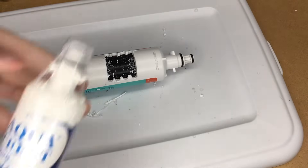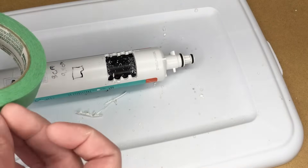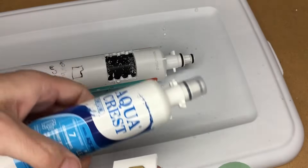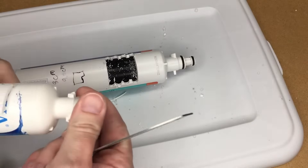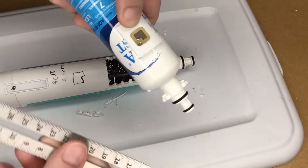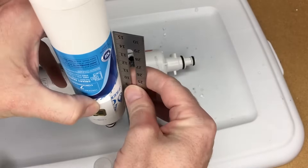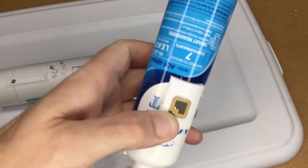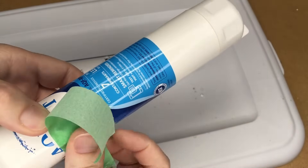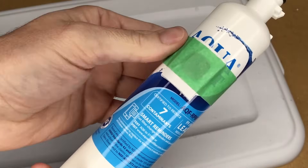That's looking better. Now I'll get the new filter out and a piece of tape. You could tape the RFID chip to the fridge in the right spot, but I'm just going to tape it to the filter for now. I had nine centimeters — it's kind of hard to show on camera, but I'm going to set this up on a surface, put the ruler next to it, and measure up to the right height. That looks good. I think I have it centered, so I'm just going to put a piece of tape over it. Now I'll go stick it back in the fridge and see if it works.